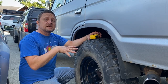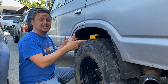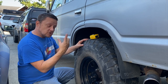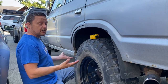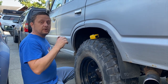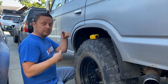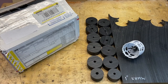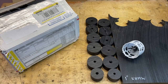There are six body mounts on each side. What you need to do is lift out some of the interior so you can get at the access holes, put a socket wrench on top, unscrew it from the bottom, pull the bolts out, and then lift everything up. I'll put some bottle jacks underneath the rockers and lift up about two inches, put the new bushings in with the spacer, then slowly lower it down. I'll need about one inch longer bolts to tie it all together. I got the poly bushings from Four Crawler Off Road — I'll put a link in the description below.